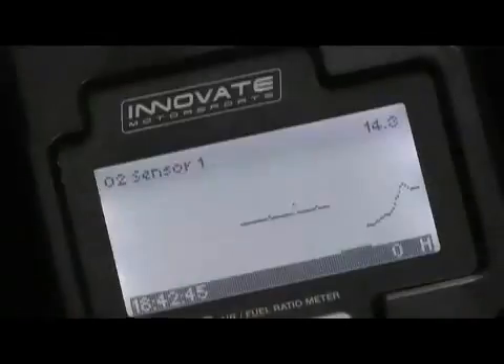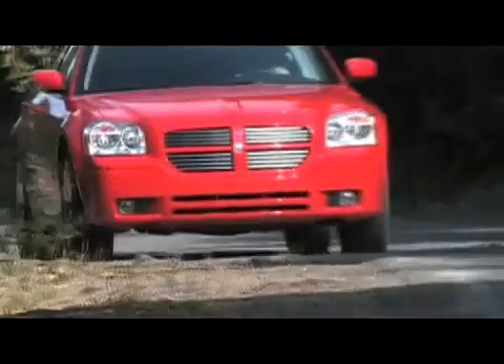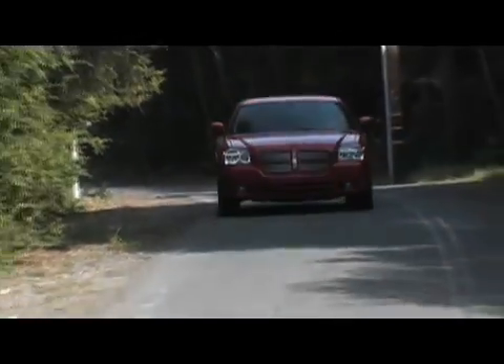Hopefully you now understand a little bit more of what the LM2 is capable of. What you probably don't realize is that this little handheld device costs under $500. Up until about five or six years ago, to get this kind of data would have cost over $4,000 in data logging and wideband equipment. Thanks to the LM2, we've now got our 5.7-litre Vortech-equipped Magnum tuned for maximum horsepower running a very safe air-fuel ratio. Till next time, my name's Bucko — thanks for watching Power TV.